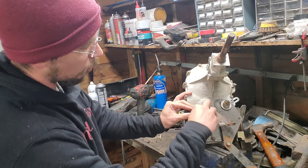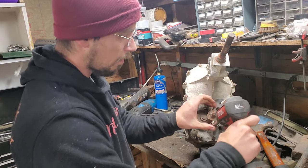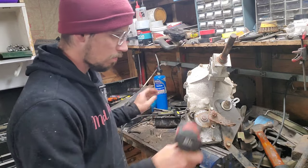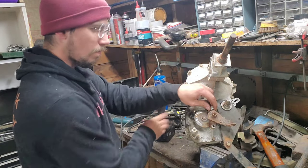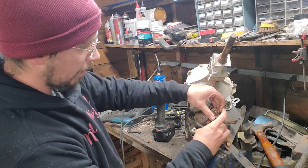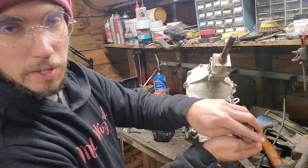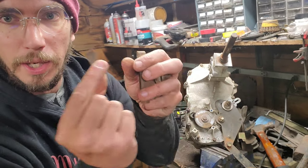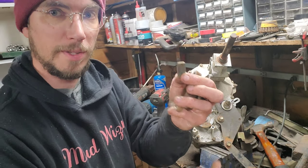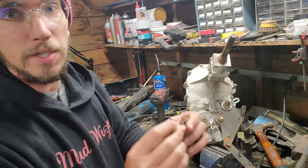This lever is keyed and will come off like so. Now we're going to take off the bolts for the brakes — there's one side, there's the other. When you pull this off, make sure you have your pad and — most importantly — this little metal piece right here. If you lose that metal piece, the pistons push directly onto the pad and will shatter it. That's what this is for, so don't lose it, and if you do lose it, cut out a new one — don't be lazy.